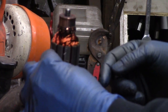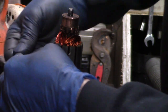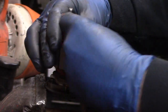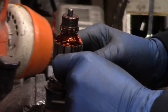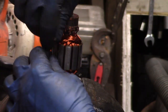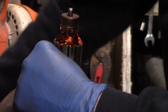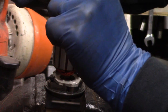There are four little allen head — socket head cap screws — that I'm going to undo. I'm just trying to get an understanding here as to why these things are failing and if there's something I can do to prevent that. The only thing I really notice is the commutator here is a little worn down, and the brushes were probably the cause of the failure because this brush is almost completely gone.